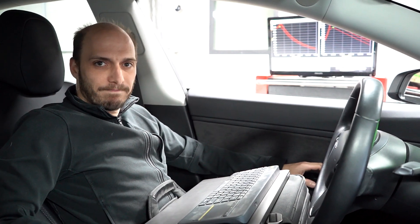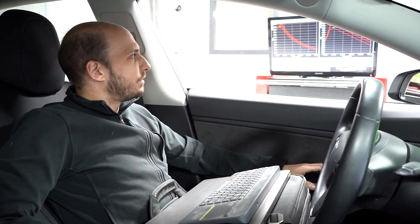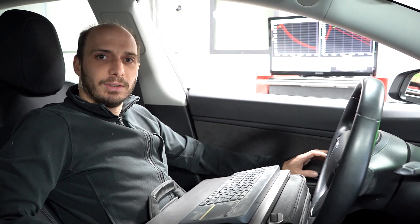So what about 45 and 55 Celsius? The internal resistance of the battery will continue to go down as the battery gets hotter, so I think 45 will be more and 55 will be more. Of course, if you start at 55 degrees, you're going to be able to run for exactly two seconds before you hit the thermal limit, so you have to balance that. Once we have all the information, we'll talk about that.